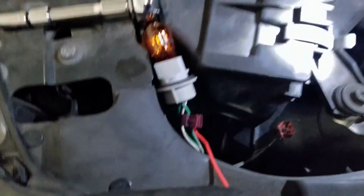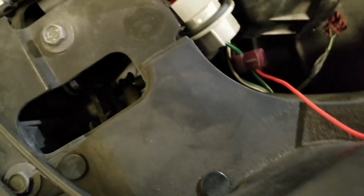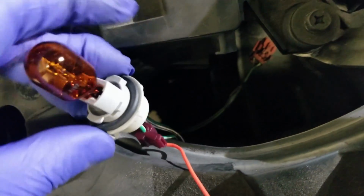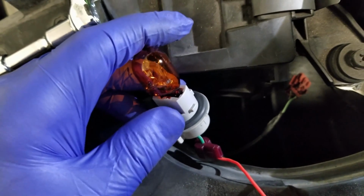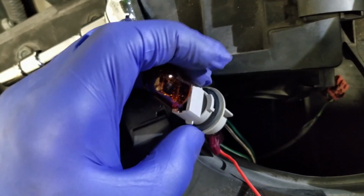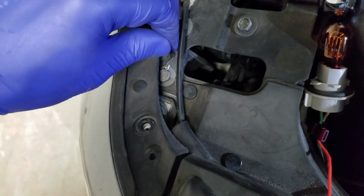All right, so I'm back, and I had to use, I believe it's called a T-tap, to tap into the green-white wire, not the green-black wire. This also doubles as your turn signal, but it stays lit when your hazards or your turn signal are on. The white one is the ground. For the ground, I'm going to connect to this right here.